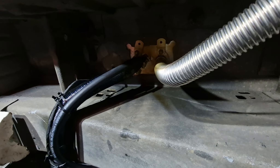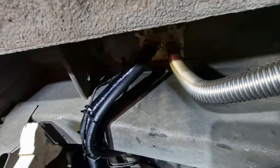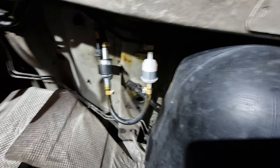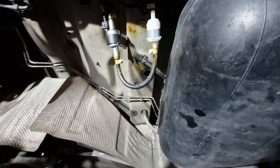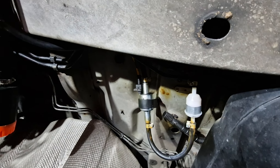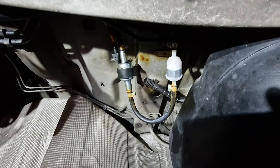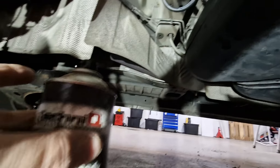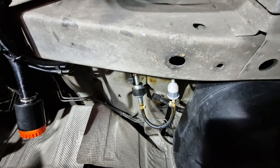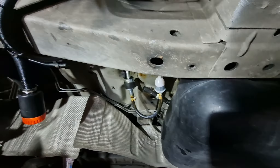That's the underside where the heater inlet, outlet and fuel comes through. The air intake is there and the fuel filter, and the pump itself is just in front of the fuel tank. It's all zip tied up. The pump is at the angle it needs to be — I think it's 20 degrees, facing upwards for the fuel to pump through correctly. All the yellow on the clips is underbody wax to stop the clips rusting. You can keep your eye on the filter to change — all of this is replaceable, but the pump and the heater itself are under the seat, so no problem.